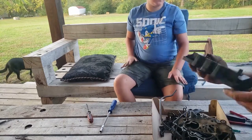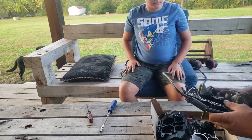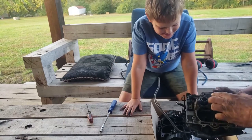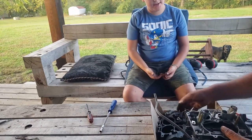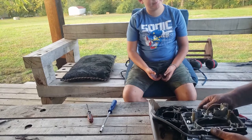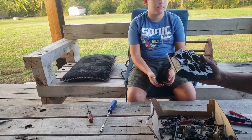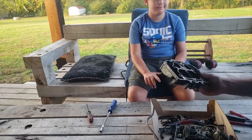Okay, so that's taking apart the Thermoquad. You did a really good job. You got everything out. You had the one float and the seats. I never told you about the seats. But you got everything out. And did this tube give you some trouble? Yeah. I was like, come on, get off. And then eventually, rip. See, the gasket is underneath it. So if the gasket gets stuck to the body here, and you try to pull this up, that gasket goes, no, I ain't letting you go. Now, when we go to put it together, we'll have to pop the tube off and take care of all that. Okay? All right. Well, that's good. So we'll take this and we'll stick it in some cleaner and boil it, clean it up, and make this thing run again.